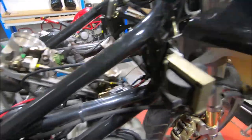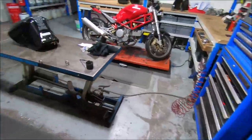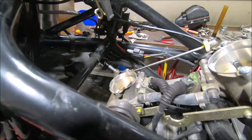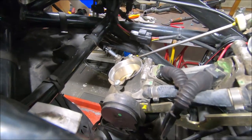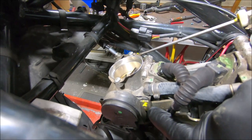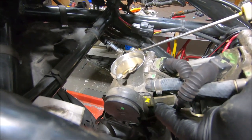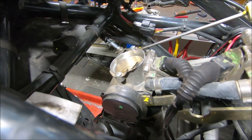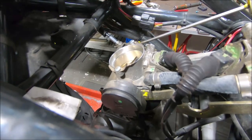This is a 2004 or 2005 ST4S and it's pretty unique in that you can see the original paint on the TPS locking screws. It's pretty rare to see that these days, so no one's ever adjusted it — we would assume it's wrong. How wrong? We'll find out.